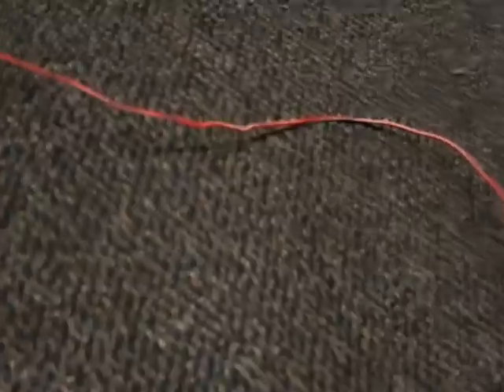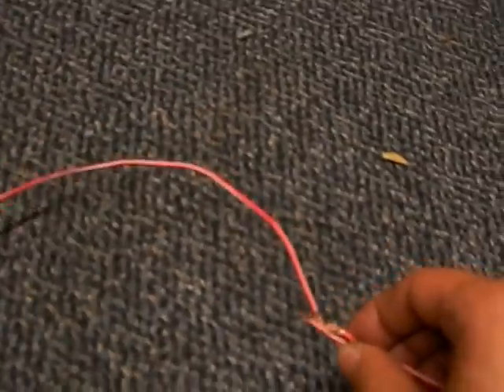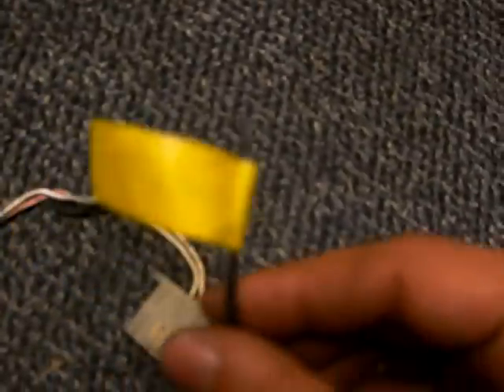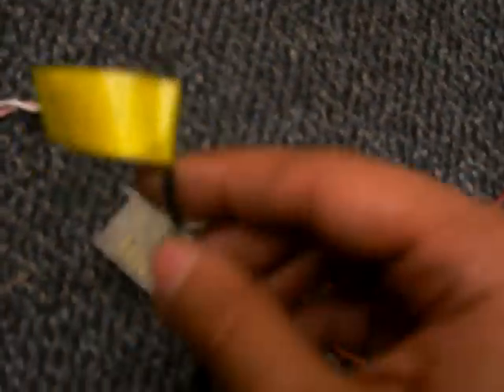There was an extra wire that I believe is for the safety relay — I don't think I need to splice that one in. On the 81 it went to the back of the bike, and I don't think I need to put it anywhere on my bike. In the end it'll basically be the igniter and the other coil spliced into the red-and-white wire coming out of the other coil, then a black wire for the ground.